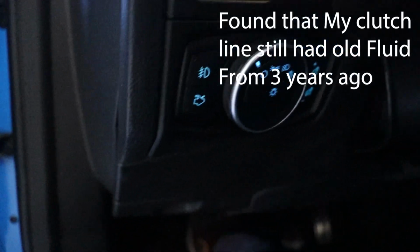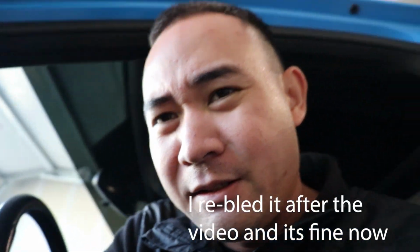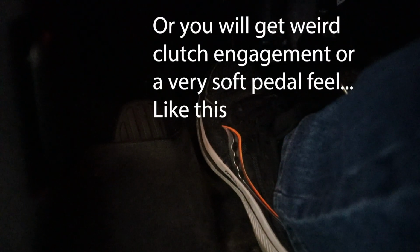I might as well get it out of the way now. The car needs a new clutch, because now when I get in the car and I hit the clutch, it only engages a little bit higher than before. So it engages right about here instead of being about midway, about there. Let me try that. Usually, with the pedal all the way to the floor, it engages about halfway. It actually kind of engages up higher now. I don't know if you can see it. It's right about here. Can't really tell.